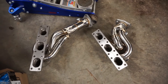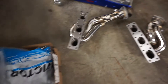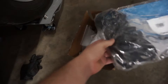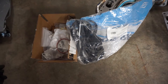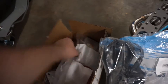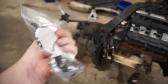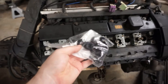We've also got some more parts here. These are eBay equal-length headers — we might as well do them while the engine's out and it's easy. And of course we've got the valve cover gasket. One thing I messed up is when you buy this, they don't come with grommets. You get the valve cover set which goes around the outside and the spark plug wells, but you also need the grommets that go around these bolts here. Thankfully I already had a grommet set — this is actually for the 540 I ordered a while back, and these are the exact same part number that these engines use as well. Don't forget these.